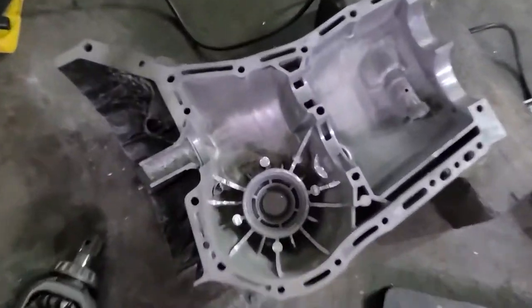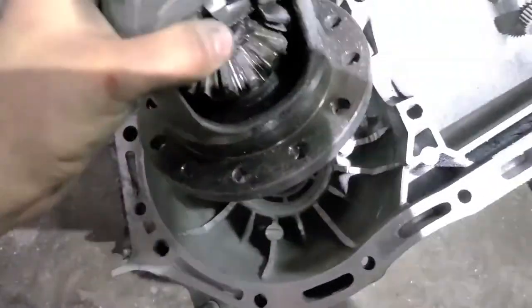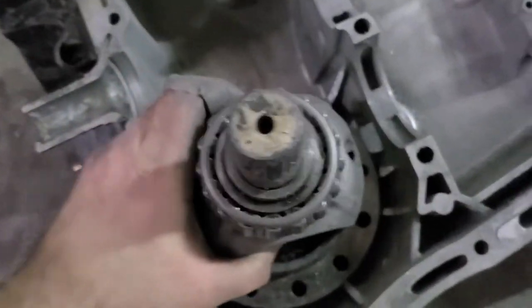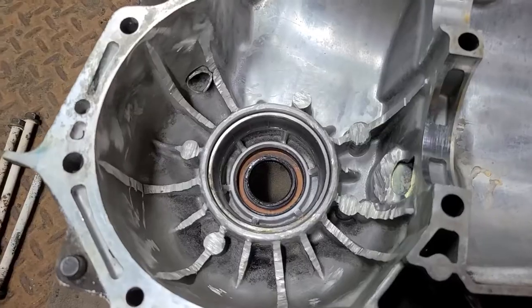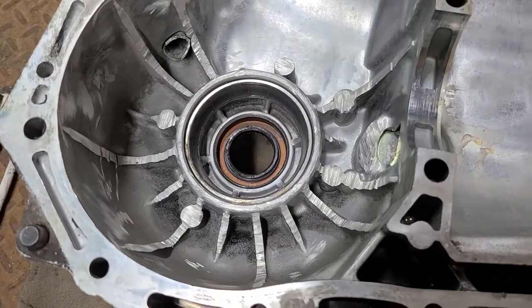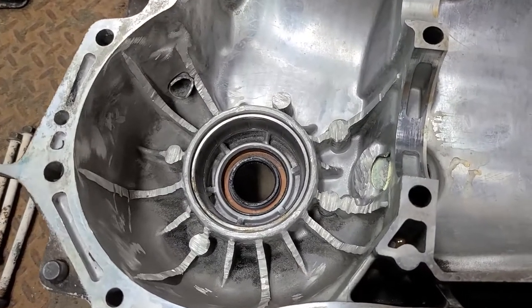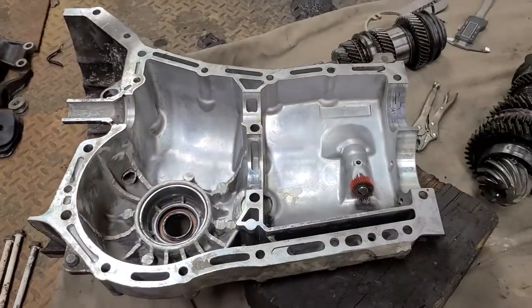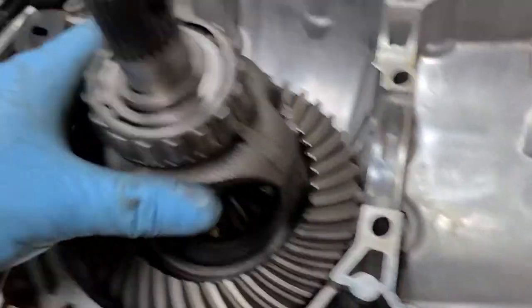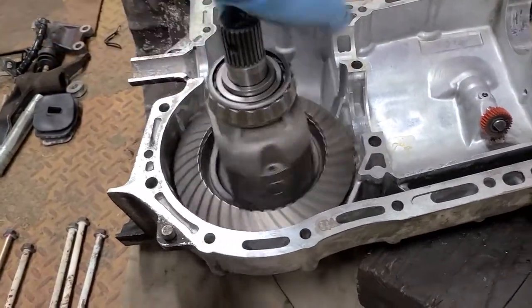After a long time, we finally got clearance for the differential without the ring gear even installed. I stuck a bolt in and checked it again — finally got everything shaved off for it to fit. Then I installed the old ring gear and still had to clear it out, then put everything in, cleaned it out really smooth.